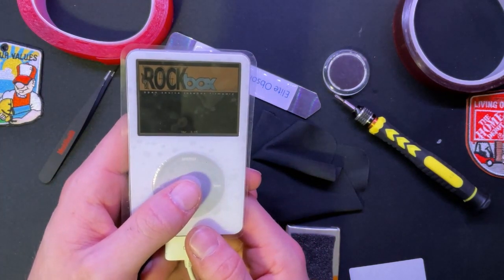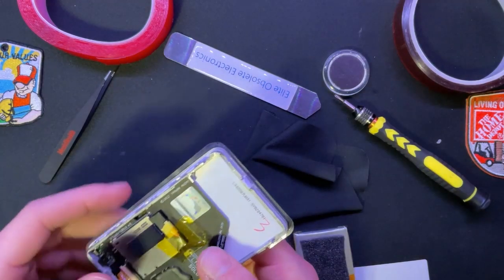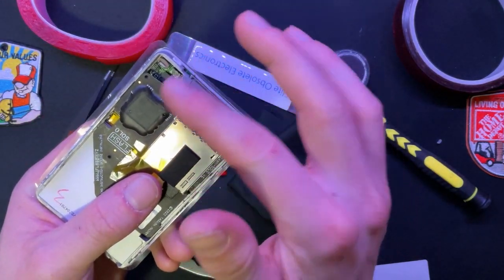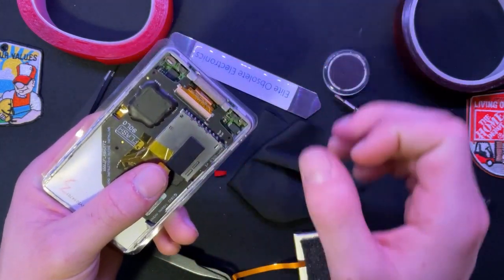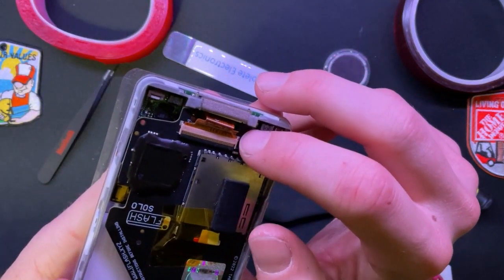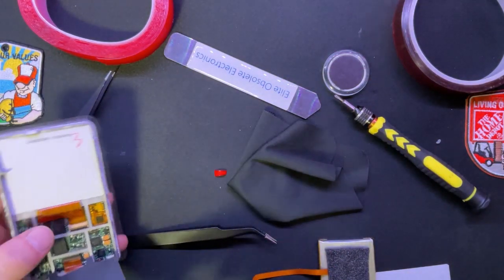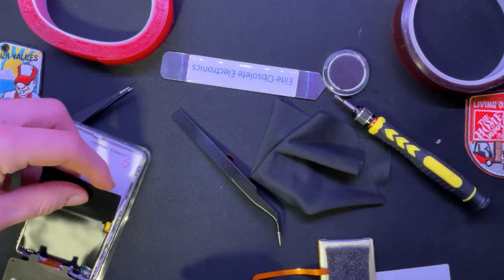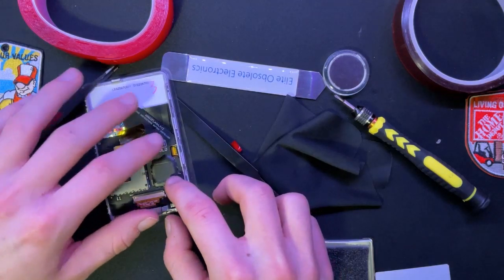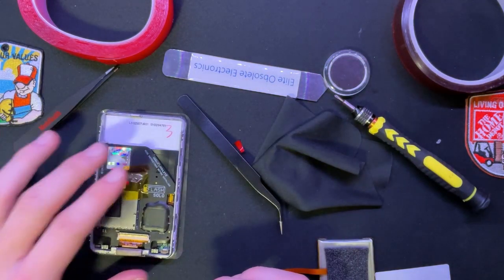It's booting - click wheel is working fine! If you ever have issues with drives being weird or half-working, do your best to get the pins all the way in, nudging them in on both sides. That's why I don't like taking this thing apart - I have to be really careful about the plastic edge because I don't want to push through and mess with one of the traces. It's working, that's good. Let's get this protective tape back in on this section so nothing's touching the board.